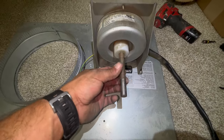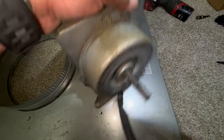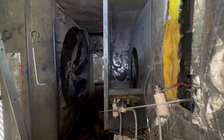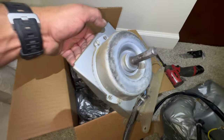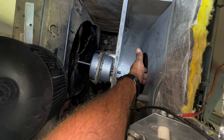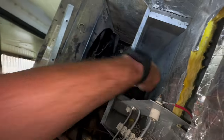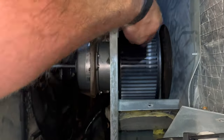All right, here it is. I haven't opened the box yet, but you're going to take the motor out and it's going to go back on this brace. You can see it was just grinding away on that plastic wheel for a long period of time. Like I expected, you have to put the mount on it — just remove these screws. The bigger screws stay as the base. This makes it incredibly hard to get to. There's no way you could do this without having the motor loose until you get both wheels on. After a very long time of struggling, I was able to get this on.